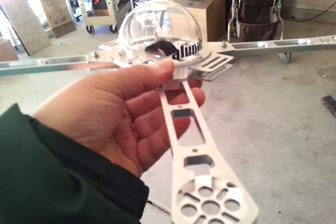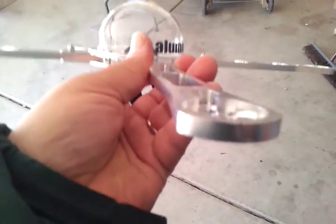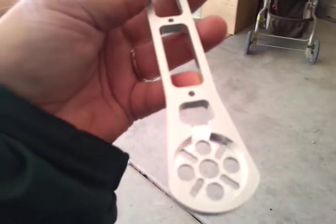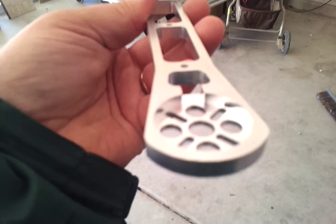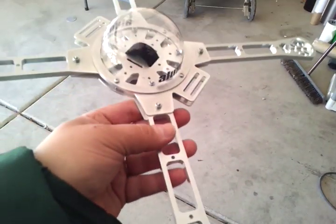That mill out there — you can run this arm upside down or the other way, just flip it over. It's flat. The benefit of having it here is you can have your motor more lower profile, so your prop's lower. And that'll fit up to a 31 millimeter diameter motor. That little hole there. Then there's a little cutout there — that's for your wires that come out of your motor so you don't bend them up. Just to make it a clean look.